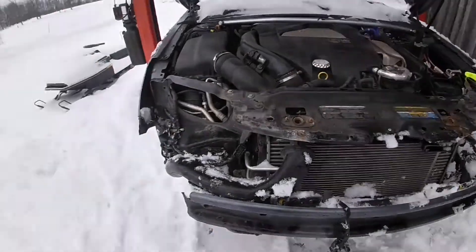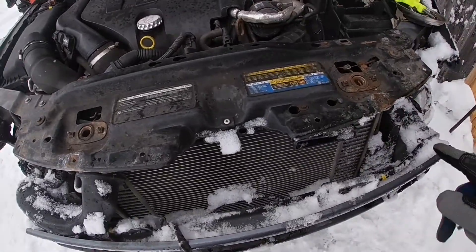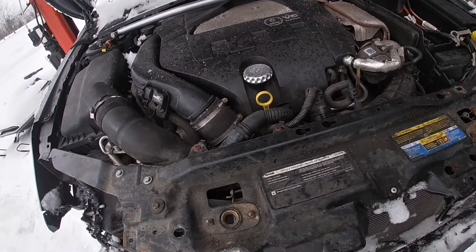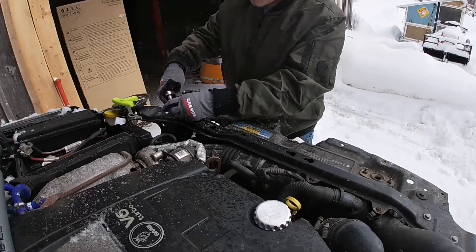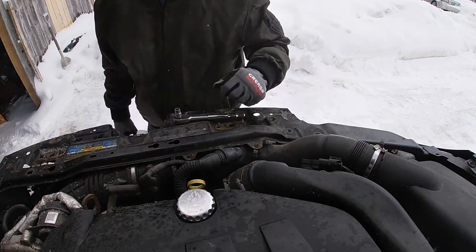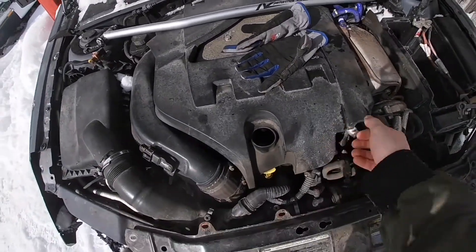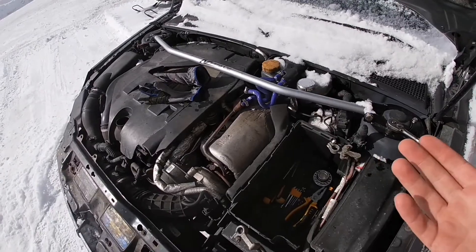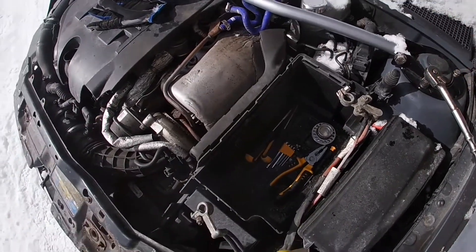Technically day two of working on this car. Now we're gonna take this plate metal off the top here so we have more access to the intercooler and radiator. After I get that off I'm gonna work on the cold air intake - but I think that'll be in the next video since I just wanted to get the things essential to all the installations off first. T20 torx - I'm gonna grab the torx and take care of those. I'm trying to get this top engine cover off. There's no linkage or anything, you just pull up and it pulls right off. However, I have a strut bar so I have to take that off because it's pinned down. I put the car back on the ground so I can just unscrew these bolts real quick, lift it, get the cover out of the way, set it back down, and put the bolts back in.